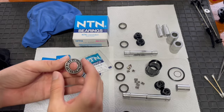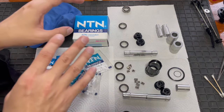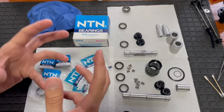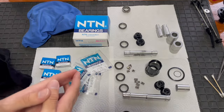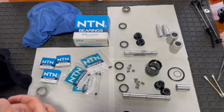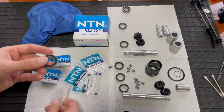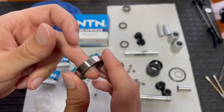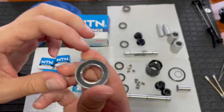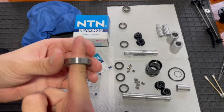With a standard steel bearing it won't run as smoothly as a new hybrid ceramic, but after a year of use the steel bearing will likely be faster and more efficient because of how quickly hybrid ceramics deteriorate. If you go for a top quality bearing like these NTN ones, it's going to be equally as good as - or possibly even better than - a hybrid ceramic. They feel absolutely fantastic, incredibly smooth and well made, and I'm really looking forward to installing them.